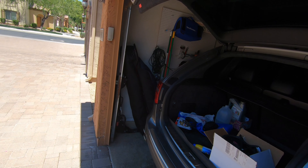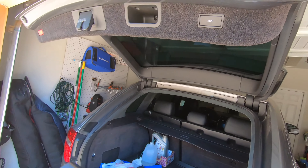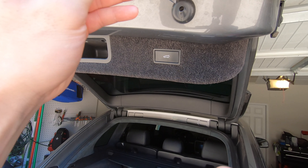Next we're going to move to the rear hatch. On each side of the hatch you have this little port. Just take a small screwdriver and make sure that when you press down on it there's a little valve in there that can open and close — as long as you can do that it should be good to go. However, if it's not moving freely, you can pull the port out, clean it from both sides, and reinsert it when you're done.